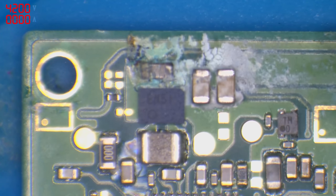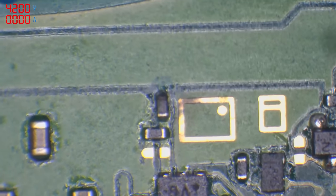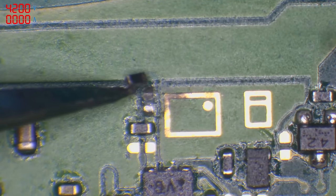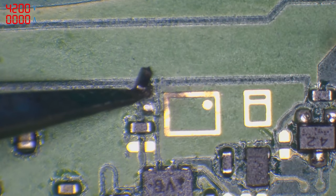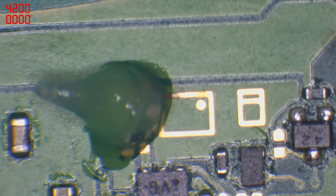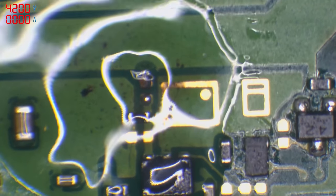Let's clean it up and see how bad this actually is. Now that I know where the damage is I can afford to clean it up. I think I might be replacing a few components around here. There's a resistor right here, and as you can see this resistor is very charred. I'm wondering if this resistor is bad or not... oh yeah, that's definitely bad — it just popped clean off. I'm going to have to replace it.